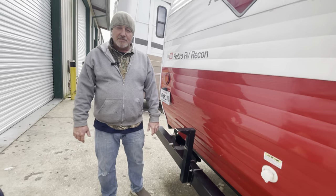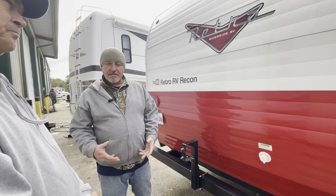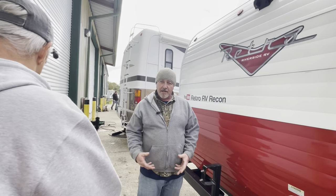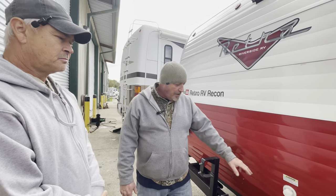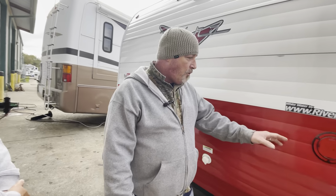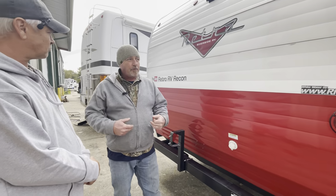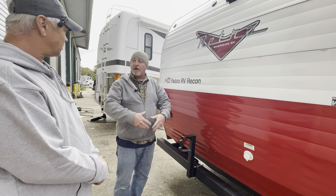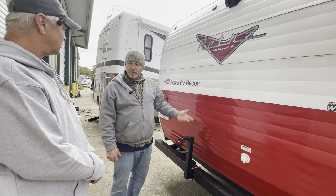I tell everyone, let's do a 30-day, a 60-day, and a 90-day maintenance schedule. The 30-day schedule is something you do every single day. You're walking around the camper, going from this side to that side, and you're looking at stuff as you walk by. It's that easy. On the 60-day, we want to get a ladder and look at the things that we can't see from down here, like these marker lights, the tops of your windows, the tops of the doors.